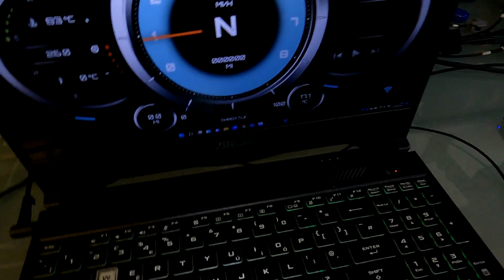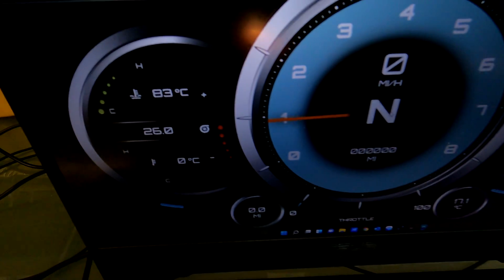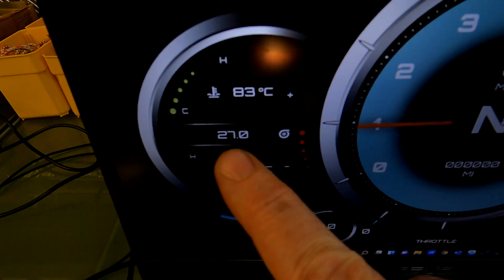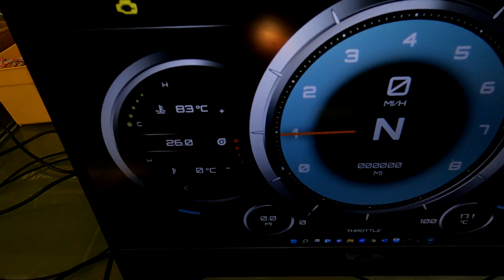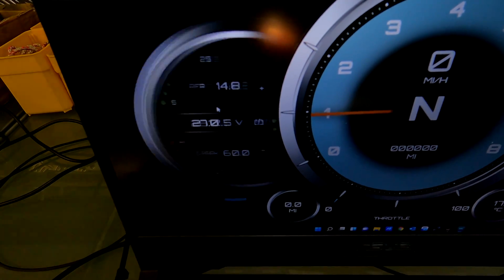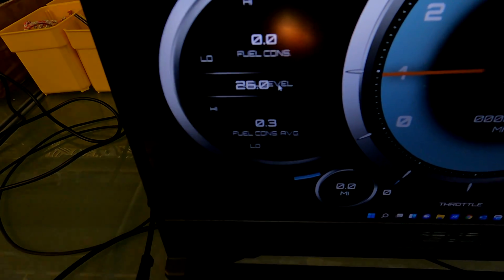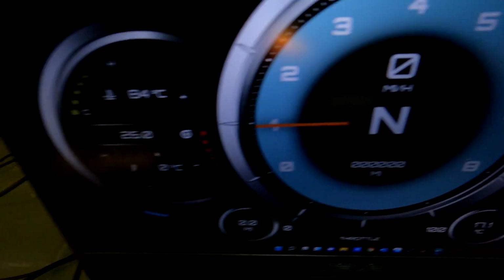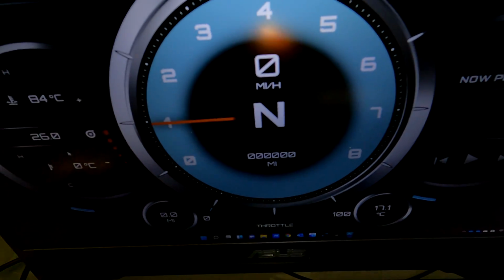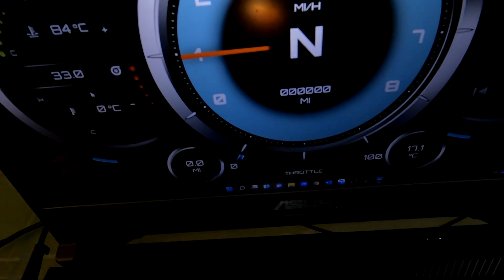And going over here now, you can actually see you're getting RPM data. There's your map sensor over there, that's your coolant temp over there, and obviously you can change all of these. So we've got nothing really relevant there, but I just wanted to show you that the Bluetooth is communicating over. We've got that over there. At the bottom is your throttle position sensor, so you'll see as I open up the throttle.